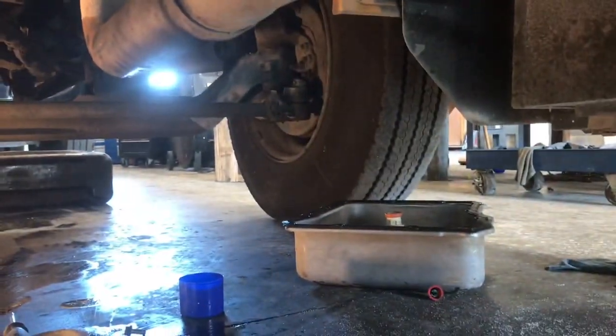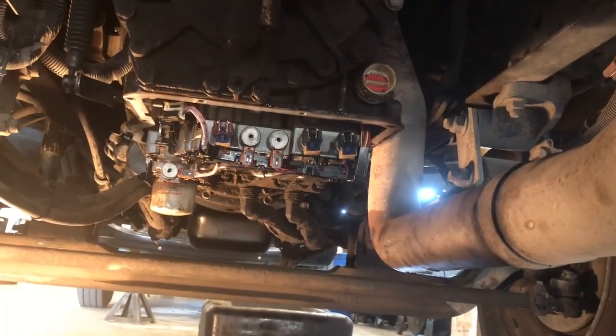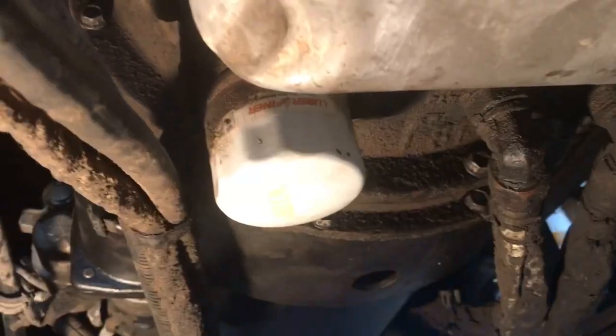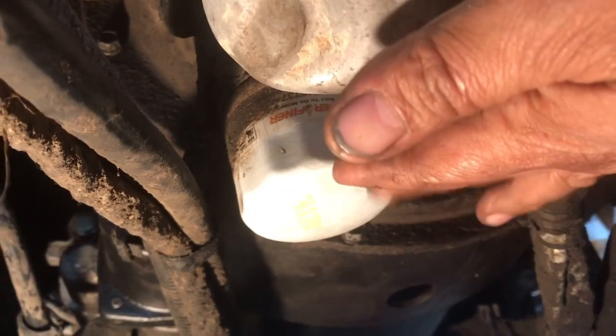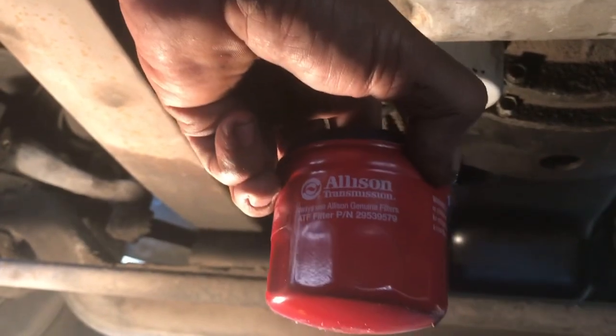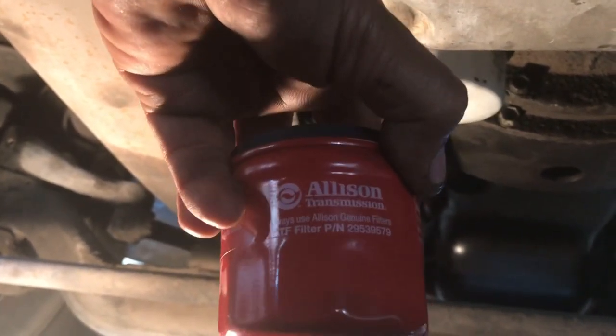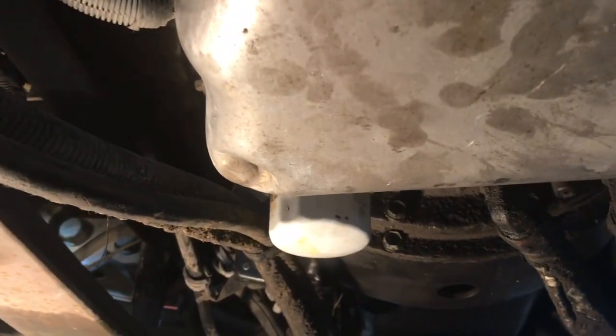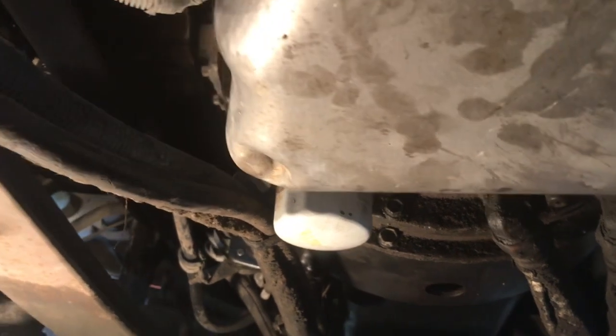Got that oil pan cleaned out and got a new filter for it. Let me go ahead and install that filter and put that pan back on, fill it up with oil and see what it does. The only thing left is to replace this little spin-on filter. They've been using a G-brand but this time I'm going to use an Allison filter. Let me get that filter wrench, spin the old one off, spin the new one on, and fill this thing up with oil.